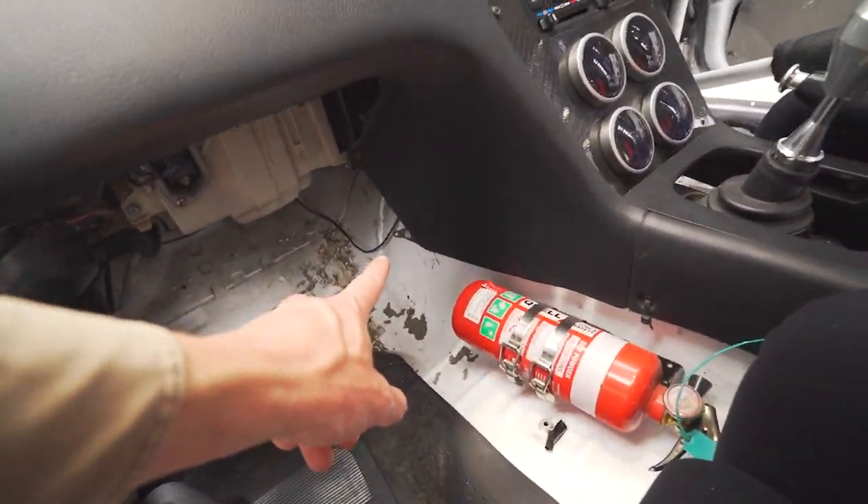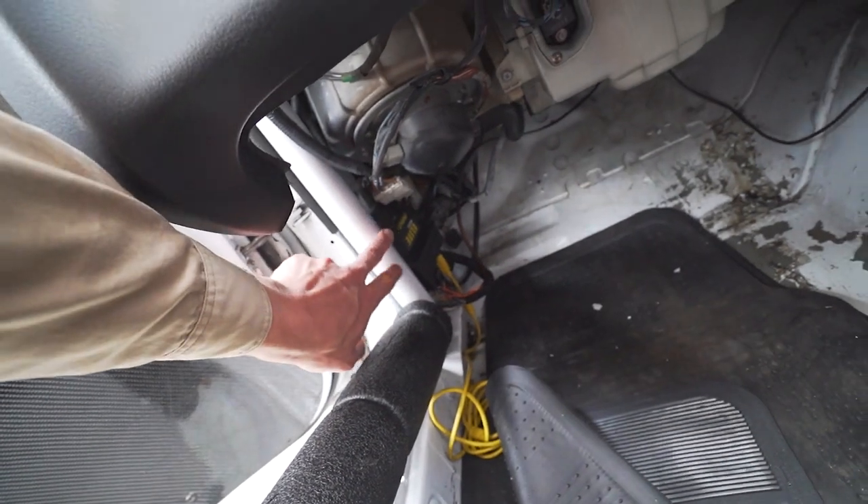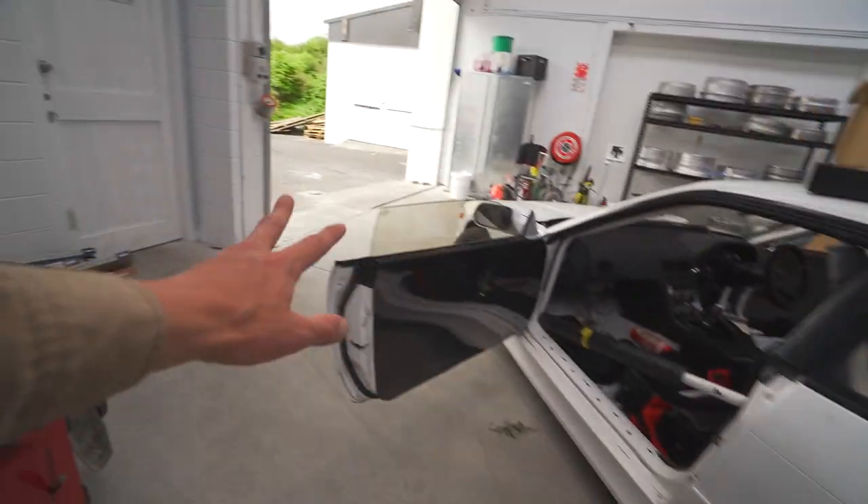I also forgot to mention that since last time we got the new ECU in the car as well, plus a dyno tune from JT Performance. He chucked in a Haltech Elite 550. The old Stinger ECU used to be back here in a very kickable position, so he's tucked the ECU up here. He said that on the dyno the valve springs were showing they're a bit weak, which is probably why the car isn't making as much power as it used to. About 10 years ago it made 250 kilowatts at the crank, and now we're on a safe 210. But with the new AR1s all around, the car feels so much faster because the power is actually being put to the ground — we were spinning in third and fourth gear with those old tires.